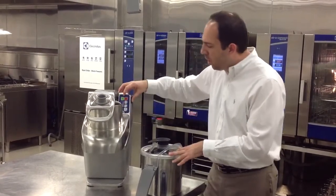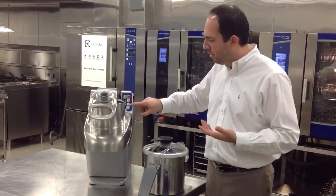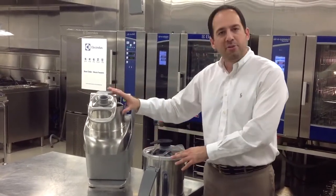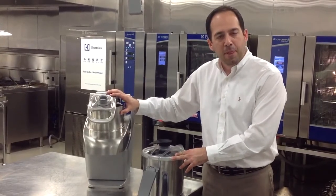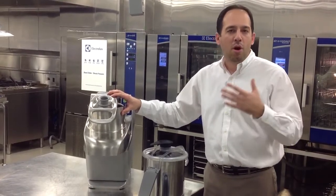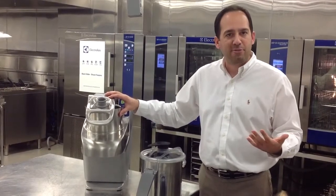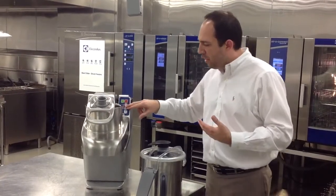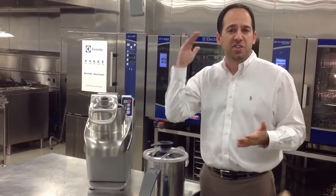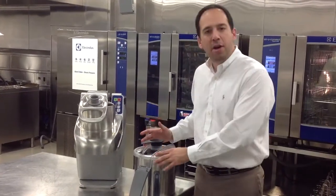The control panel is no longer just a single speed on-off panel. You now have the ability to toggle between ten different levels on a food processor and four different levels on a vegetable slicer, giving you the ability to lower RPMs for more sensitive vegetables or riper tomatoes. Switching assemblies automatically gives you the ability to go from speed one to speed ten, which is 3,500 RPMs max on a bowl assembly.